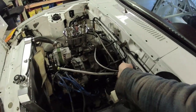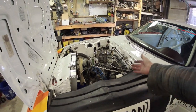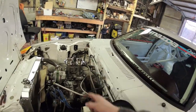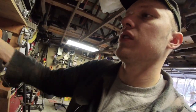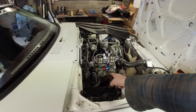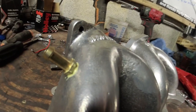This is the universal throttle cable from Mr. Gasket. You can use a 12A throttle cable — it will be long enough and the same price — but this gives me a lot more flexibility with how the end mounts. The 12A cable has a lead ball in the end, so you're pretty much stuck with it. I went with the universal one. I also drilled and tapped the Racing Beat lower intake manifold for a barb fitting so we can hook up the brake booster — not sure why it didn't come with a port already.